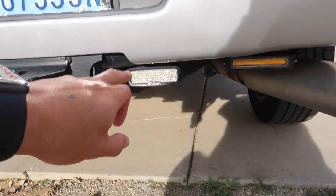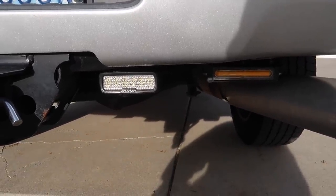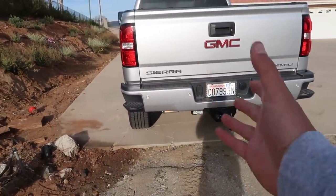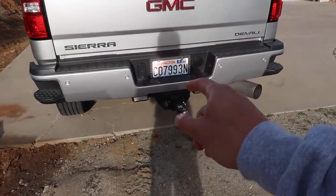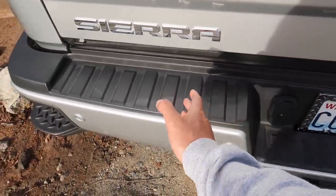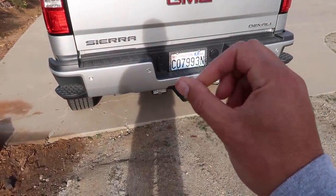The reason he came in — these reverse lights stopped working, and this is really crucial guys. I'm getting a lot of trucks in here with the same problem: rats and mice. He thought we blew a fuse, but I traced the wire and noticed I had power all the way to a certain point. Then less than a foot over, voltage dropped from 12.2 to 2.2. A rat had chewed through the power cable, causing it to short out on the frame.